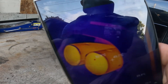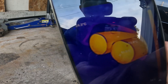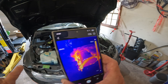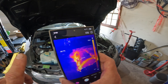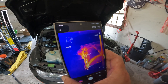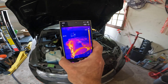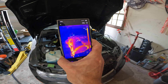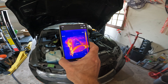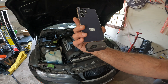You can see the exhaust signature — if you had a small leak, you'd absolutely see a hot spot. I have an electrical connector right over here; if it was left loose or a battery terminal was loose, this would show up as a heat signature and you'd catch it before it caused a problem. When you can give a customer a clear visible picture of a failure, it helps you sell the job and solve the problem.